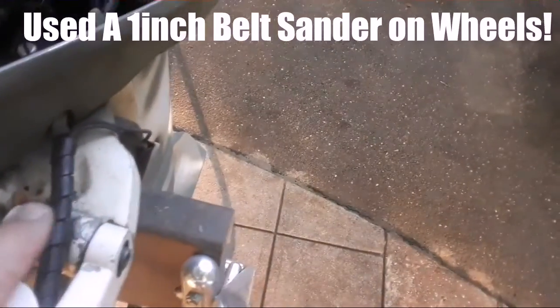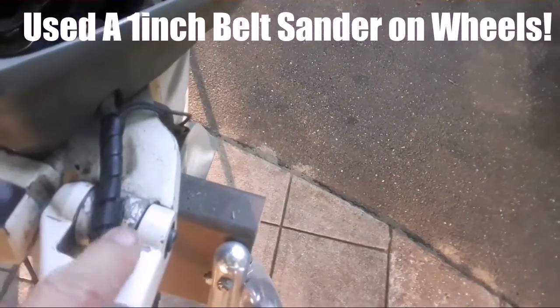I want to show you something else. I got the tiller all mounted. Kind of made my own bushings and spacer for this. Saved myself another $40 to buy the bushings and the bolt and the nut. So I just took a piece of fuel line, put a bolt through it, sanded it down to the ID of the stern bracket hole.